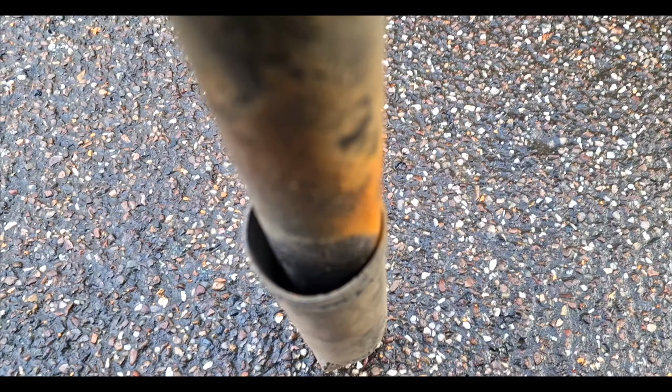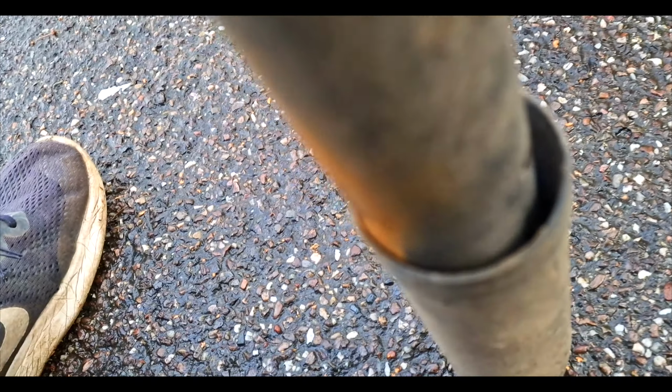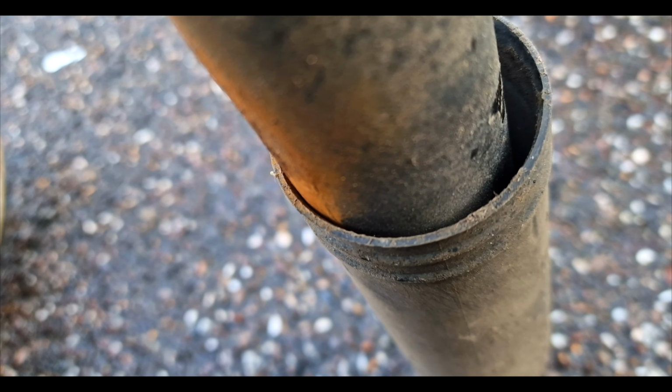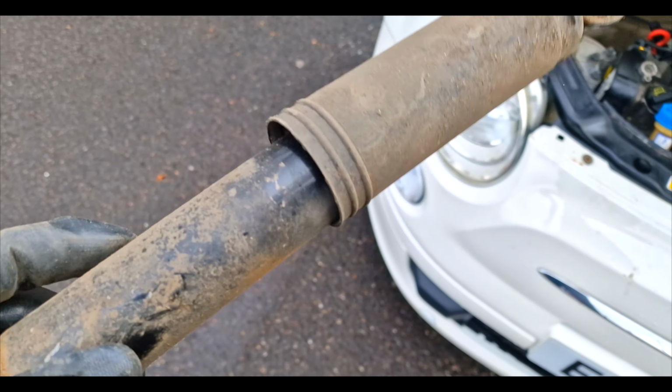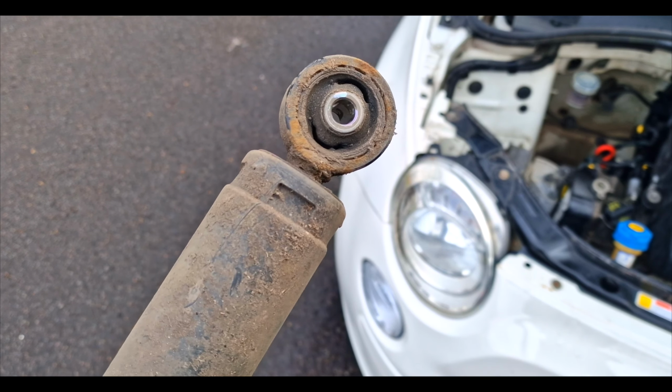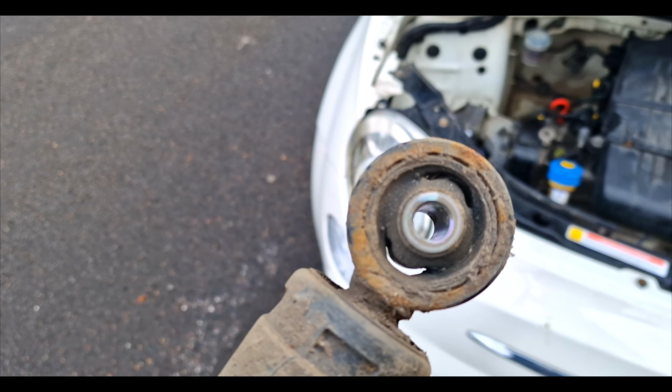So it's out. I'm going to try and show you, or get you to listen to this annoying squeak. Hopefully the phone will pick it up. If I push down on it, hopefully you can pick that up. So I'm going to bin that off. Get rid of that. I think it could be the original. It's very, very old. But it's certainly within the strut, and it's certainly not these that are causing the issue.